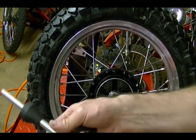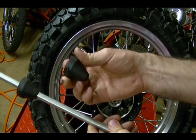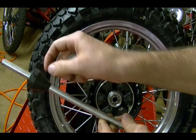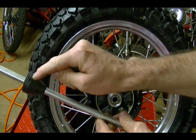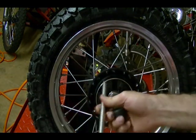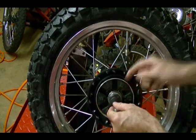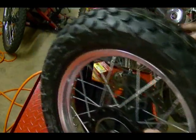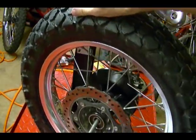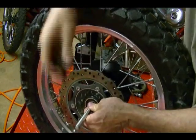The way that you set this tool up is you have an axle here. You've got two centering cones and each centering cone has a set screw. You want to attach one centering cone to the axle and set it. Then what you do is you take this piece and insert it through your rim, center the centering cone, and then come around to the other side and attach the other centering cone and tighten it down.